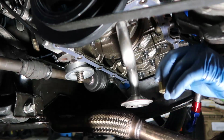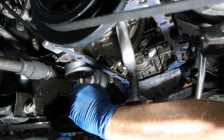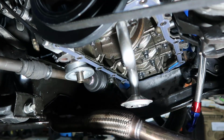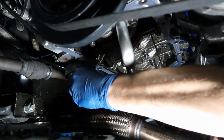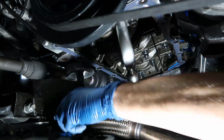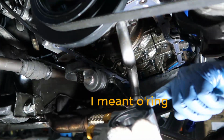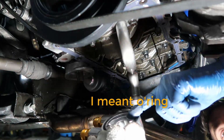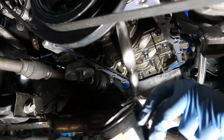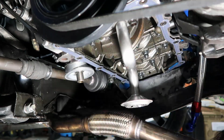We have two fittings, so you can choose what fits in your car. One is metric, this one, which you see is a little loose, and the other one is SAE. So you have to figure out what's best for you and just use it. You should not have any leaks if this is sitting properly, because you have this gasket right in here and another gasket on your filter. By the way, using this, my filter got smaller, and what I'm using is this Wix 51348. I'm going to put the link in the description.